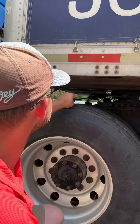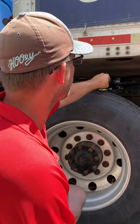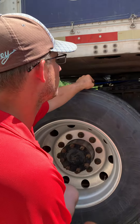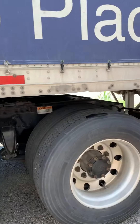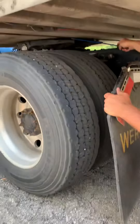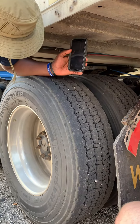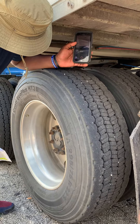My pull pin is not crack damaged or loose and is in the lock position. My platform is not crack damaged or loose. My platform pin is not crack damaged or loose and it's not missing. My locking jaws are not crack damaged or loose — they're in the lock position, completely around the king pin. My king pin is not crack damaged or loose, it's not bent, and it's properly greased.